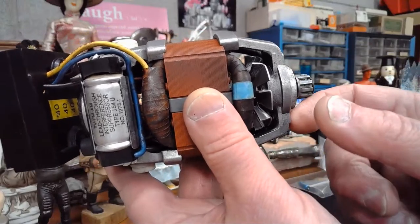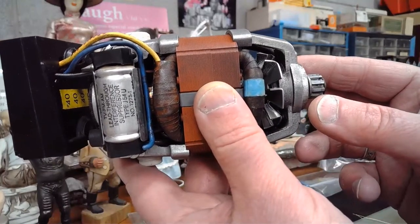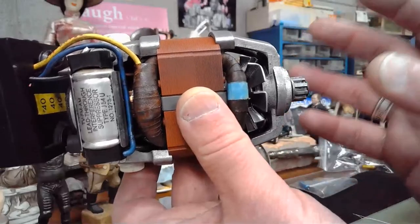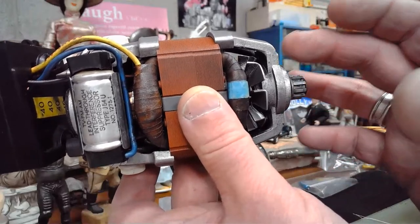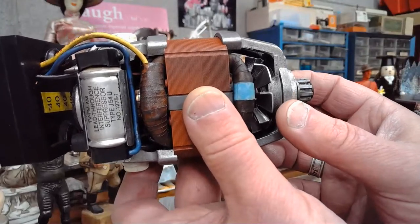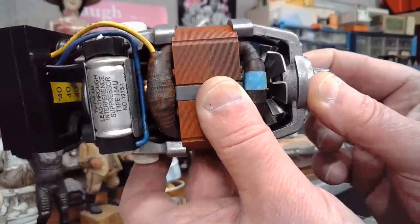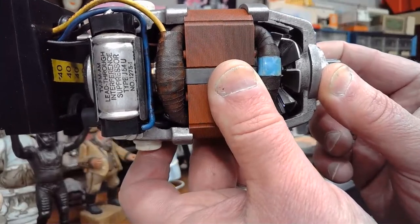Again, you don't want to go with a generic liquid rubber or an RV style liquid rubber because they're not going to be designed to resist oil or heat. And a lot of those black liquid rubbers, they make them black because they want them to stand out as something that will be able to work in a motor space without allowing that oil-rich environment to degrade that liquid rubber more rapidly. But again, if that rubber boot is not holding this motor in a fixed position, then that motor, when you step on the foot controller, might be pitching, and it will affect that belt tensioning. And